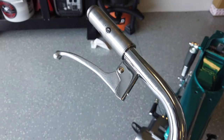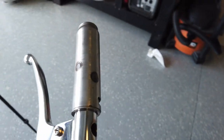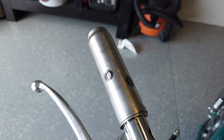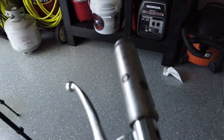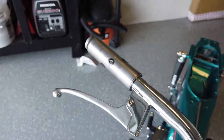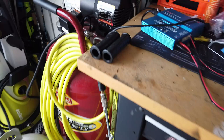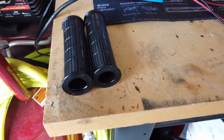The throttle assembly is all complete. I just need to throw on the grips. For a more detailed look at exactly how all the components go together, I'll post a link in the description to Minibike Mike's video where he does this on the bench with a broken piece of handlebars so you can see very clearly how the screw on the bottom connects. To put on the grips, I always just use hairspray — spray it into the grips and they slip right on. The hairspray ends up acting like a glue later to hold it pretty tight.